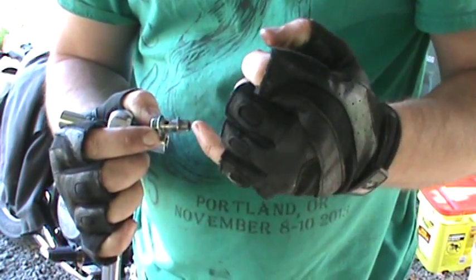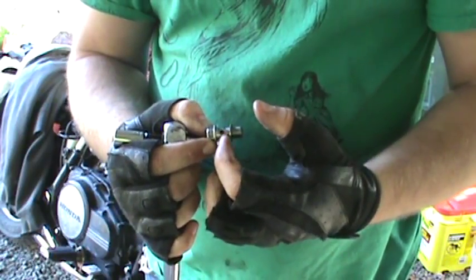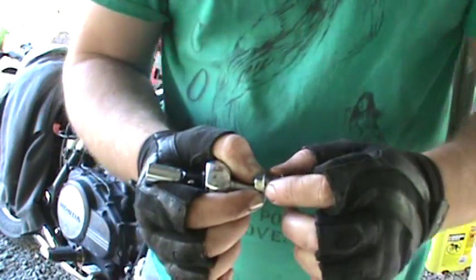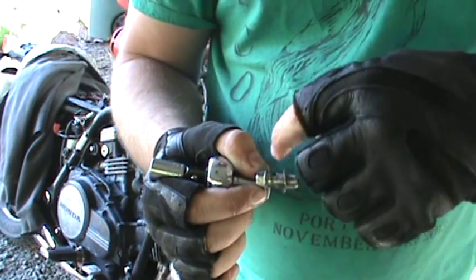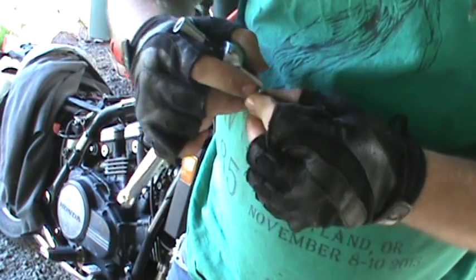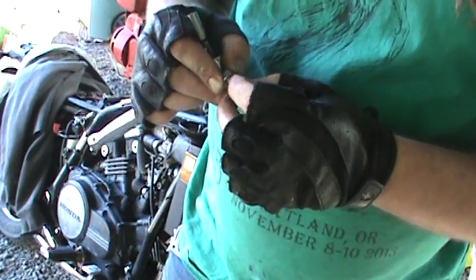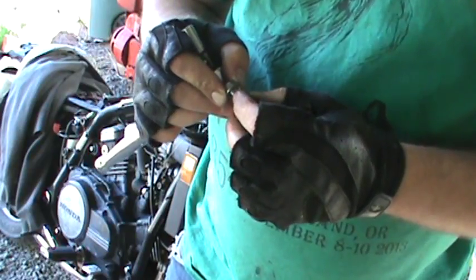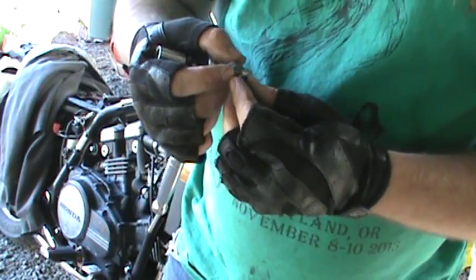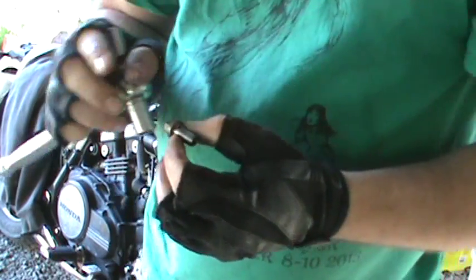If you have it where you have the end of the hose and then the gasket, you end up with a bit of a leak here, and this is too far into the, I don't even know what the name of the attachment is called, but the end of that hose has a little running edge on it, and that's where you have a hole here and a hole here. If you can see that there, hole here, hole down here, and then it goes up into your hose. So if you have the washer on this end of that pipe, your brake line, then this hole is too far down, so you don't have the right amount of pressure or the right placement of the pressure. So you want it all the way tight against there, just so that you see that up close.